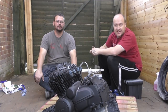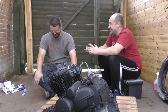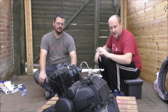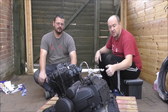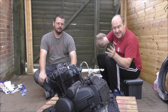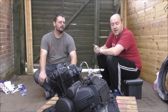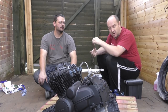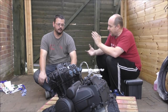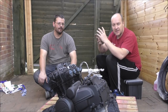So here endeth today's lesson, stroke, episode. And, sorry, what have we done today? Well, we've painted, we've degreased, rubbed down, etched up and painted the engine, the forks, the brake drum, the bracket for the brake caliper, and wheels. The wheels, indeed, the wheels, yes. We now have to let that dry, and the next time we're on this bike, it's putting it together time. So, it's rebuild. I'm looking forward to that. Can't wait to see all that stuff, all that hard work come together.